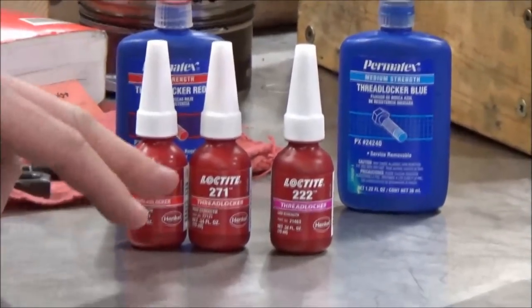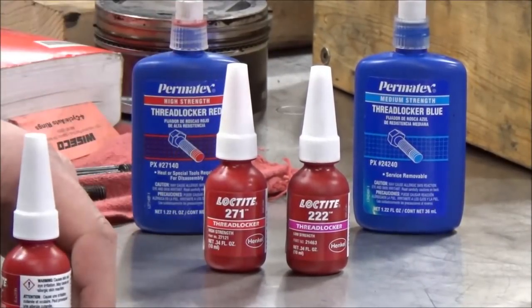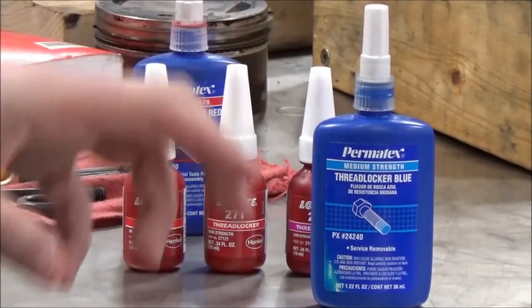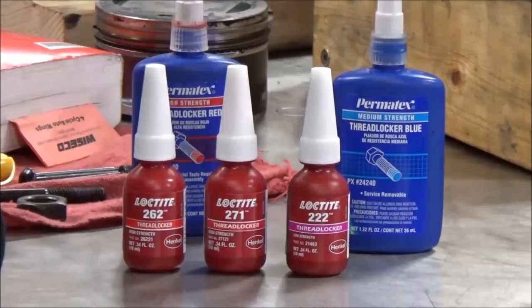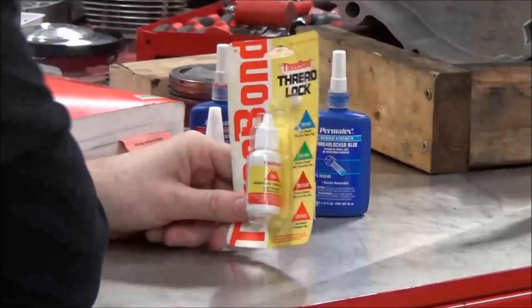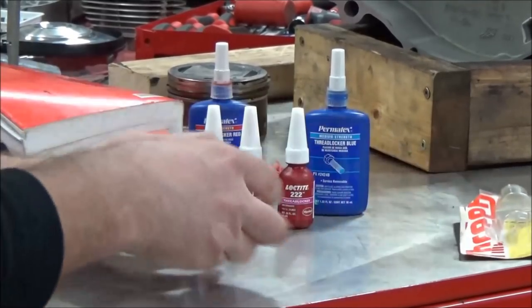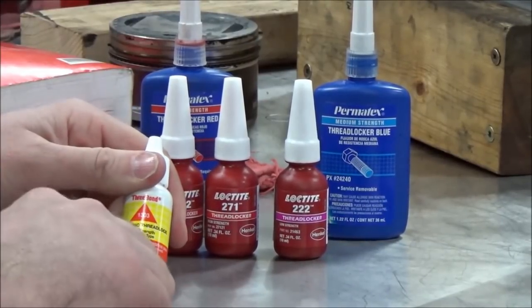Let's do every mechanic's typical practices. When you're a tech and you see a bottle of Loctite sitting on a bench, how many times have you heard somebody say, 'Grab the red Loctite'? Or somebody says, 'Grab the blue Loctite'? We typically relate the strength of the Loctite to the color — we think blue is medium and red is more of a high strength. Here's another company used in the powersports industry, and honestly I think a big reason it's used is it's really inexpensive. This one here is orangish-red, and it says that it's high strength.